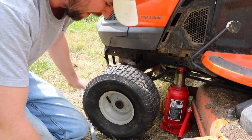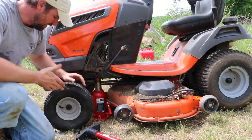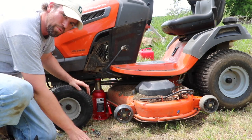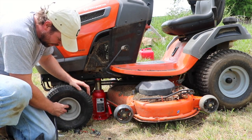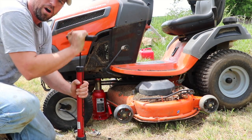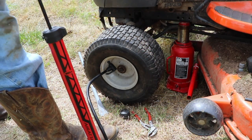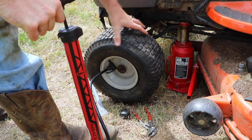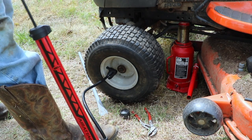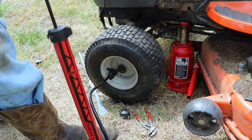I'm going to pump air into the tire while it is lifted up like this. When putting air into a tire this size, it's often recommended that you use a bicycle pump or a hand pump, because an air compressor could expand your inner tube way too quickly, over-inflate it, and then you're back to doing the repair all over again. Tires this size are so small it takes just a few seconds to pump them up. You can see that as I pump this up, the tire is expanding into place and resealing itself along the rim. The inner tube is adjusting itself inside because the weight is off the tire, giving it ample room to expand and shift into position.